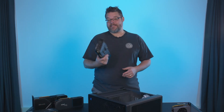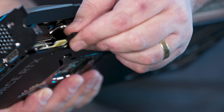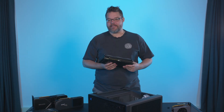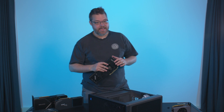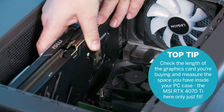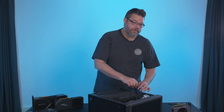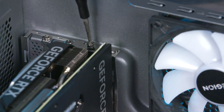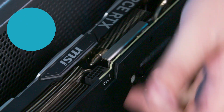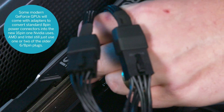Step 3: In with the new. First thing to do is remove all those annoying little plastic grommets that get stuck into the video ports and on the PCI video connector at the bottom. Firm but gentle is the order of the day here. You don't need a lot of force to set your graphics card in its slot, but you will need to push it down. There might also be some unpleasant scratchy noises as you do, but that's mostly normal. When it's seated in place, the bracket should line up with the backplate, and you'll be able to screw it down and fix it in there permanently — or at least until the next time you need to upgrade. Before you shut your PC up, don't forget to plug in the power cables. I can't tell you how many times I've forgotten and booted up my PC and wondered why there's nothing happening on screen.